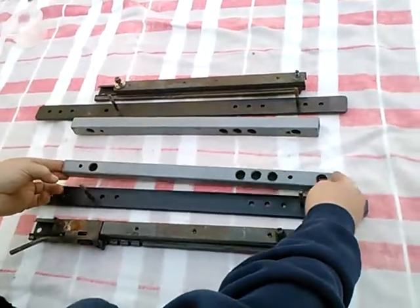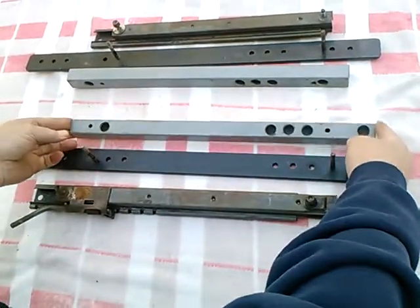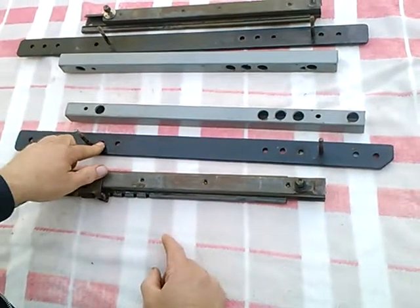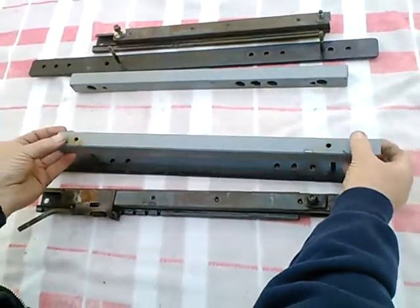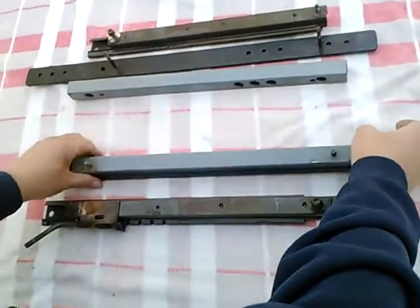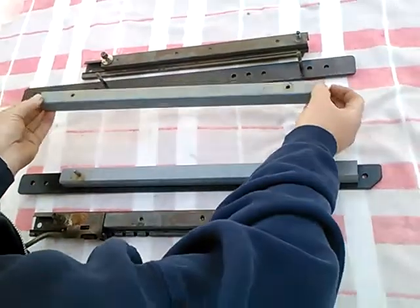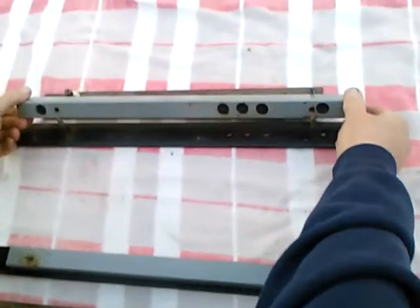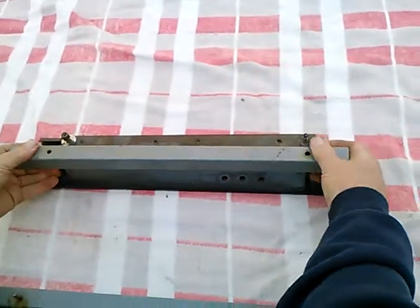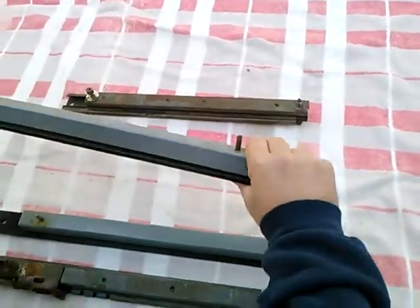The other aspect of it is these spacers, to give about the same offset up from the floor. They have the small holes to drop over the studs, and then these very large diameter holes to fit over the bolt heads coming up through the floor wherever they might be. So that drops onto there pretty easily once it's bolted into the floor, and then the seat goes onto the top. The opposite side — and this is all on the driver's side — it looks different but wound up very close to that, though this one's a little tougher to get to drop down.